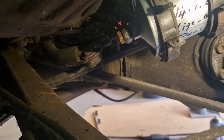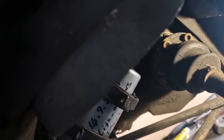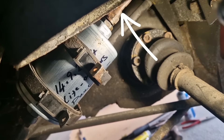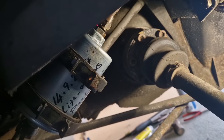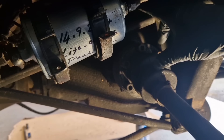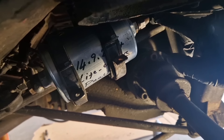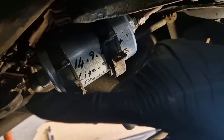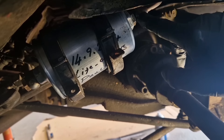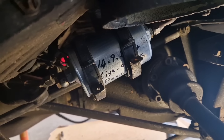There's a banjo at that end with a copper washer each side — that cracks off quite easily. The back one is a union that goes onto another union that then goes into the filter. That outer union on the pipe — I think that's a compression fit onto the fuel pipe because it doesn't wind off. The way to do it is to take the clamps down, remove that, crack the inner union off from the filter, spin the filter out, put the new one back in quickly. Let's get the brackets back on.